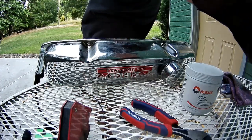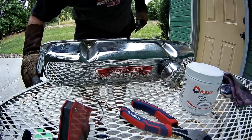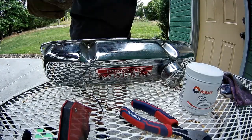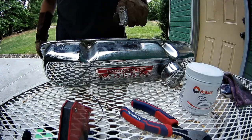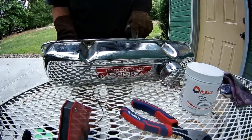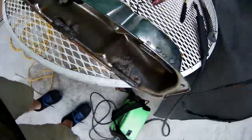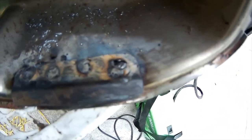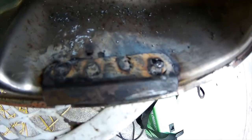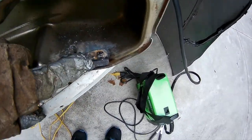Well, that was successful — it's a long time coming. And that last one only got a little sloppy, started burning through it. That's a pretty good little welder though. Once you get whatever you're doing dialed in — it's hard to weld stainless and soft steel together, but I got it done. As long as it stayed smooth, it stayed smooth on most of them. The first one was a little bubble-gummy but not bad. The brackets just need to hold the gasket from sliding in — that's all they have to do. And once the gasket grabs, that's enough.